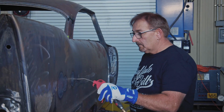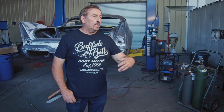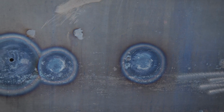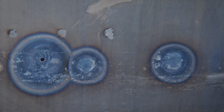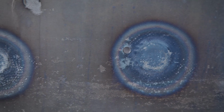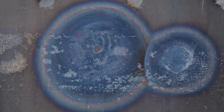We are finished with all of our metal work, so right now we're down to just working on the body, which is mud, mud, mud, fixing all the seams on it, fixing all the little rust pockets up at the top. Once we have the mud work done on it, we can send it over to Will. He can get the primer going on it. We'll be able to start doing some paint work, which is good because I think we have like 45 days now until Christine has to be at the red carpet event on Monday night.